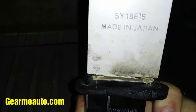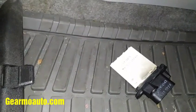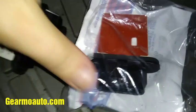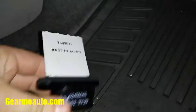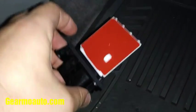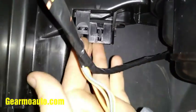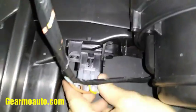This one is a solid-state resistor — kind of like a microchip. Check for burn marks or if it looks burnt or deformed — you may have a bad one. My problem wasn't this, but I thought it was because my air was turning off and on intermittently. Here's what the new one looks like — the part numbers are on the front. To put it back in, it's easy: just slide it in and it'll pop right in. Be careful with it, put your connector back on, and that's how you get it replaced.